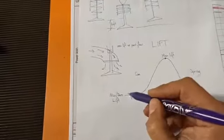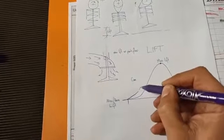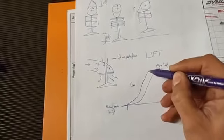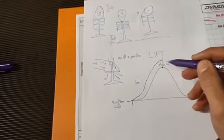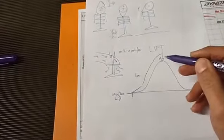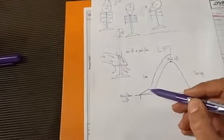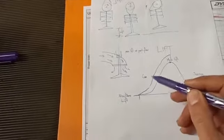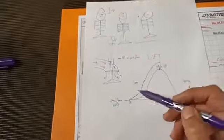So this is a cam that's got, say, a given amount of lift, and if we were to draw one that's got the same duration but more lift, duration we'll come to in a minute, then the curve would look something like this. It'd come up, so then our peak lift would get somewhere here, and I'll only draw half the curve. You guys follow me, and then you know where the valve's going to basically end up. So when you've got more lift, the cam has to push much harder. It needs to accelerate the valve a lot faster, so there's a lot more wear and tear. There's a lot more stress and strain on the whole mechanism for high lift.